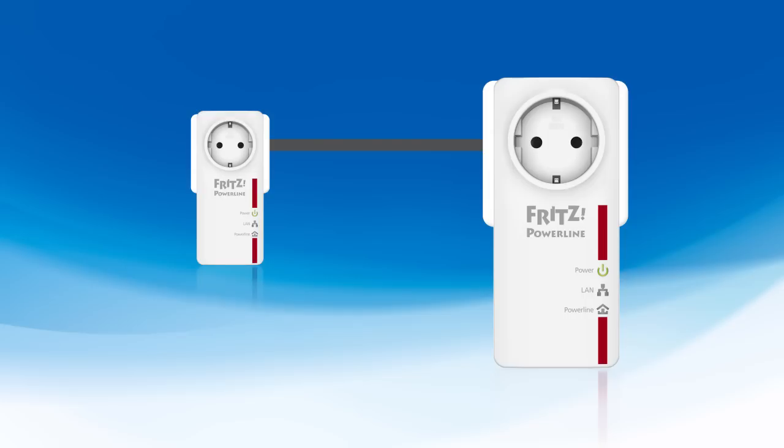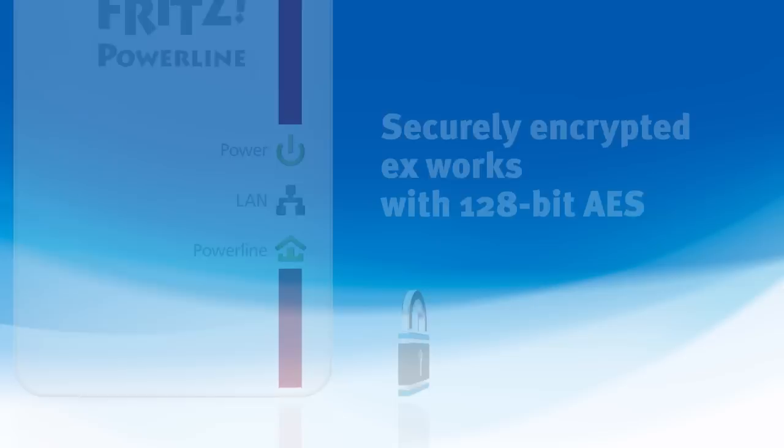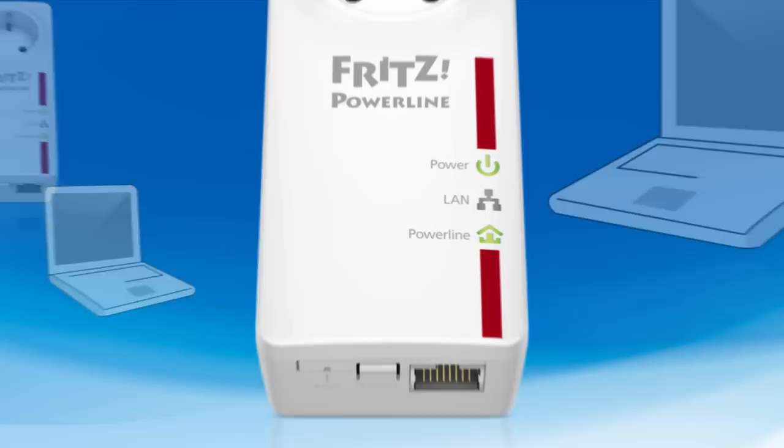The Powerline LED on the FRITZ Powerline devices signals a secure, automatically configured connection with 128-bit AES encryption. To connect a device to the network, simply plug it into the LAN port on the given FRITZ Powerline device. Setup is complete once all LEDs are green.